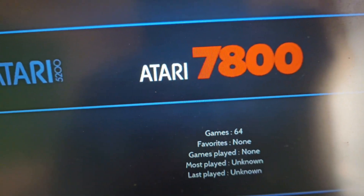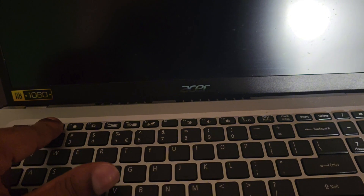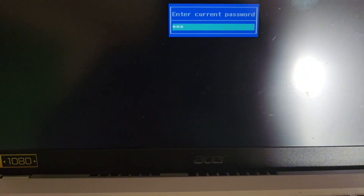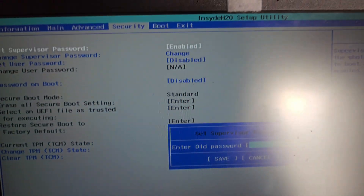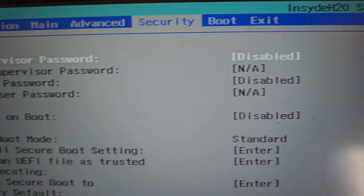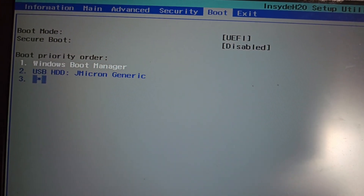I also want to show you how to turn off the password so you don't forget it. Shut the computer back down and go back to the BIOS menu using F2. It'll ask you to enter the password — mine was simple. Once you're in, go to Security, find where it says Enable, put in your password, press Enter, and say Yes. The password is now disabled, but your Secure Boot will still be disabled.